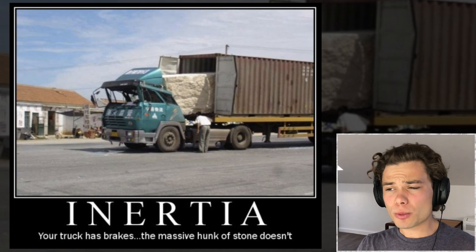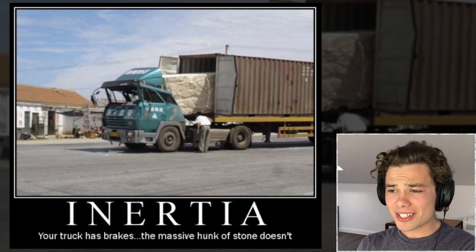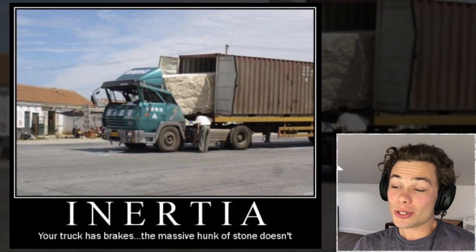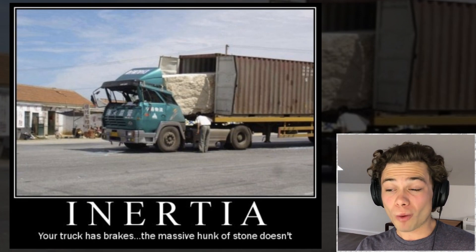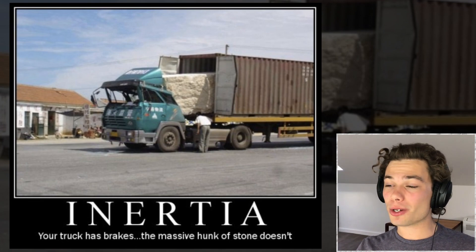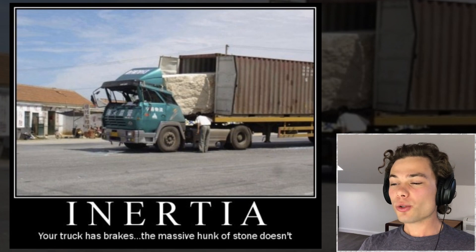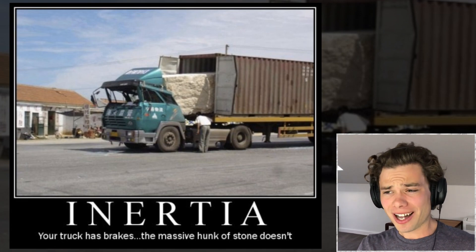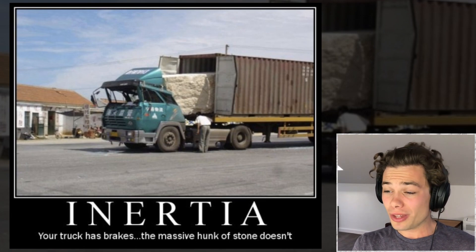Because we see this type of thing on these subs so often, it makes me wonder how often people are getting cleaned out by these massive lumps. I can only imagine a majority of truck drivers wouldn't check a load that is in the container — they'd go, okay, it's come from overseas, it's been shipped around already, I don't need to check it. And then all of a sudden you just have a rock coming through and touching you on the shoulder. You've got to use these posts for educational purposes. This is a perfectly educational post — I can't imagine anyone would let this happen to them twice. Just always check that your load is secure. Even in a container, just check everything is secure and make sure it's on the right kind of truck — a flatbed tray where you can seat and strap it down correctly.